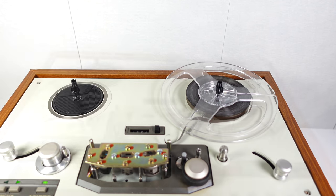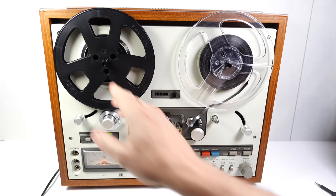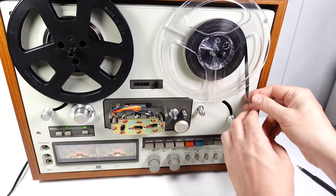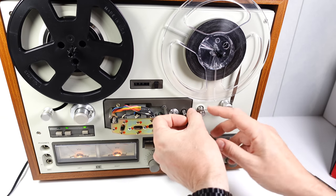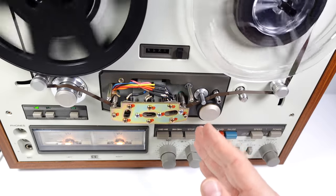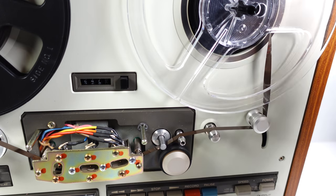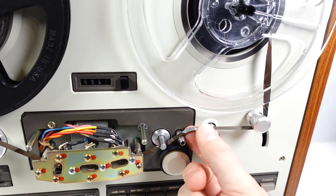I pop a plastic reel on and bring the tape back across, and this time I put the twist in it so it comes back the right way around for the playhead. Now the brown side is facing upwards toward the heads. As it passes through I'm looking for the foil splice which signifies the end of the tape — I can cut at that point and put leader on either side. We're nearly at the end and I haven't seen it yet... hold on — there it was. Good timing.